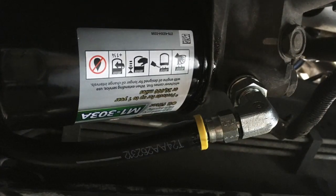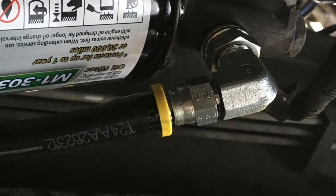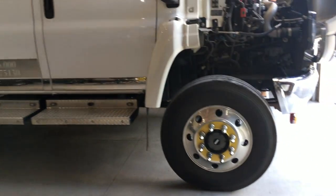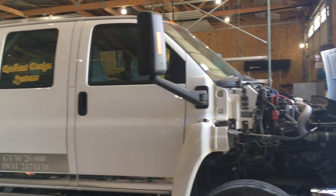This is how it should look. We simply pulled the bottom plug out of the stock oil filter housing and installed the Duramax pressure fitting from the installation kit. This longer hose runs up to the center or in-port on the filter. With the stock oil and filter changed and cleaned, we verify all fittings and hoses are good and tight and fire it up for 10 to 30 seconds. Verify there are no oil leaks and top off the oil if needed.